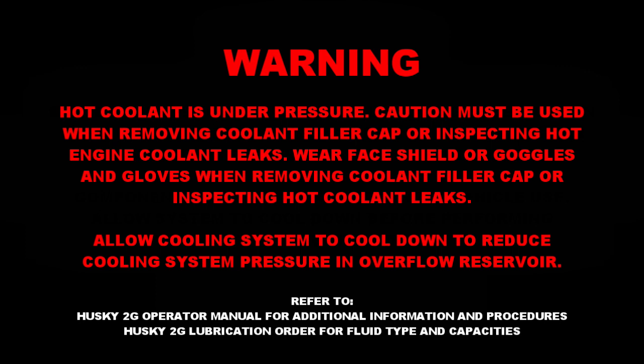Hot coolant is under pressure. Caution must be used when removing coolant filler cap or inspecting hot engine coolant leaks. Wear face shield or goggles and gloves when removing coolant filler cap or inspecting hot coolant leaks. Allow cooling system to cool down to reduce cooling system pressure in overflow reservoir.